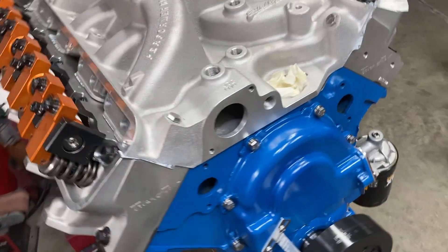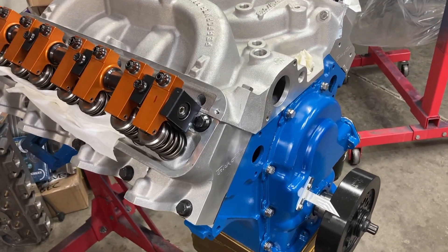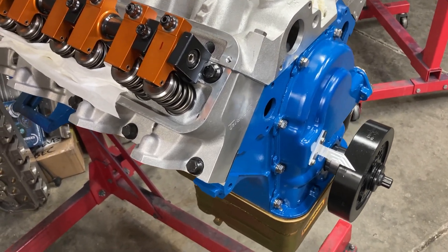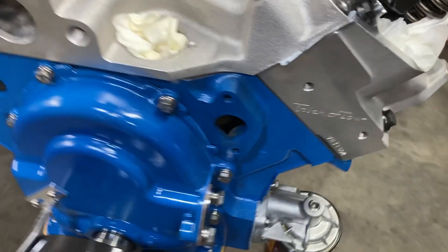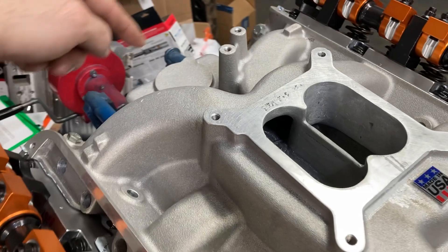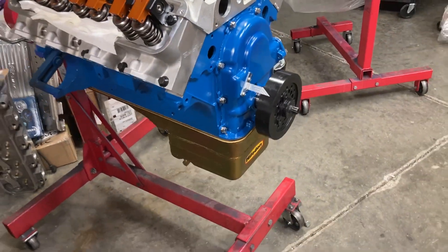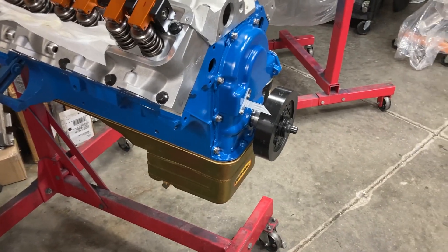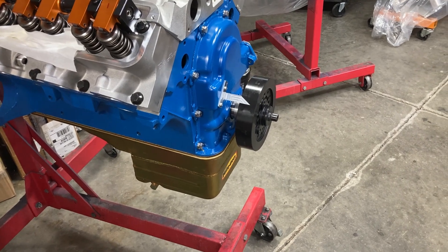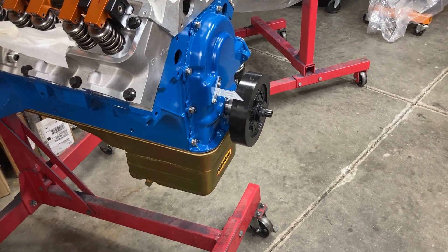You also get into five and six stage pumps — one pressure stage and then either four or five scavenges. You can also scavenge from the lifter valley, from under the valve cover, and that sort of thing. The pros of a dry sump setup are that you always have oil pressure. You could almost literally drive the car upside down and you would have oil pressure.